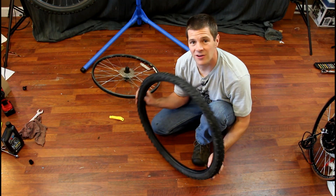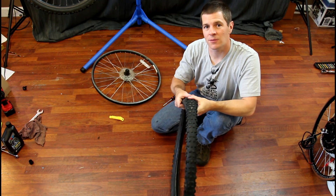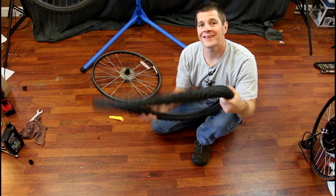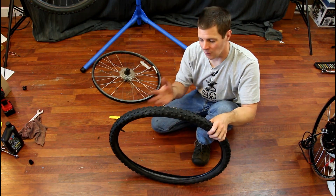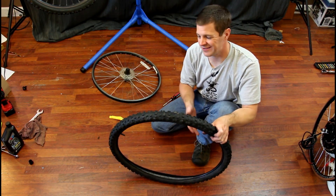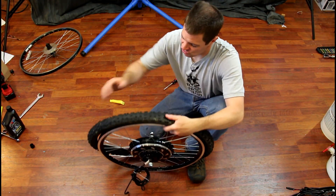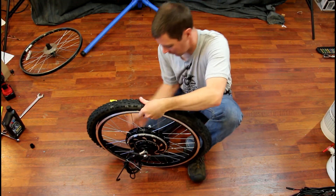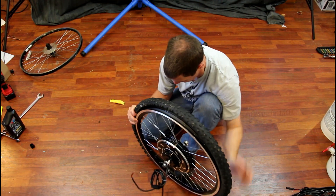Before installing this on the motor, make sure there's a little bit of air in the tube — this will keep you from getting a pinch flat when you try to install it on your new wheel. Also pay attention to the rotation direction; it'll be marked on the tire because you don't want the tire to rotate the opposite direction, otherwise it won't get proper grip on the trail. To mount a bicycle tire, do one side at a time — don't try to run both sides onto the rim at once because that's quite difficult.